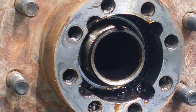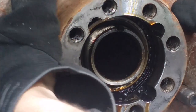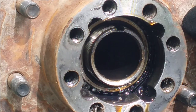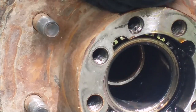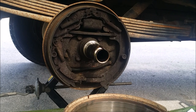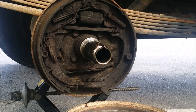Now that that's out, the drum will just slide off. It's a little bit heavy, so be careful - don't put your feet underneath it. The bearings inside - there are two of them - they stay inside the drum when you pull it off, so don't try to get those out. There's the drum off. That's what the inside looks like if you had really bad brake fluid leaks that collected dust and dirt. It should not be as black as this.